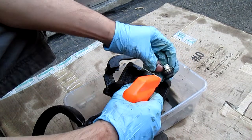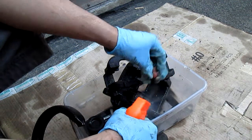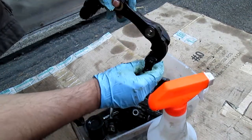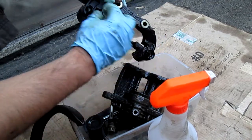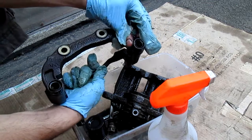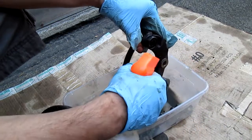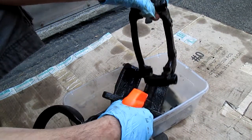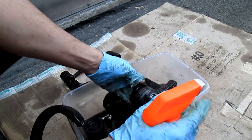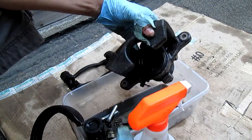These bolts — just spray them like this right here. It'll take a lot of stuff off and it's a lot easier than brake cleaners. You know, you can spray brake cleaner, but most of these parts are aluminum and especially in here there's no way you'll be able to get all that gunk out, especially brake fluid — it won't come out.